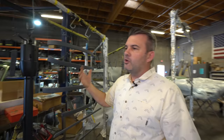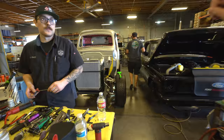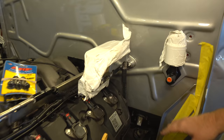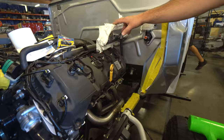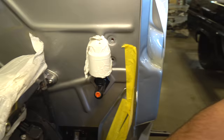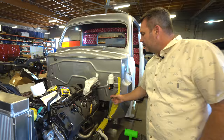We're putting the '49 together for good now. We've got an electric master cylinder — there's an electric pump to help create vacuum. It puts out around 1,200-1,300 PSI to the calipers, which is a lot. This is our clutch master. It's gravity fed, then forces back up through to the two brakes — works really well in tight situations, and this is a tight situation with no room for a booster. Since this guy is actually going to tow with a trailer, manual brakes just didn't feel like the wise thing to do.